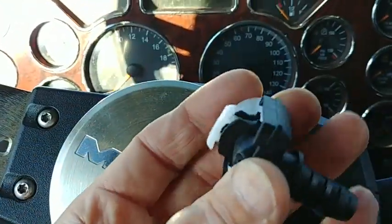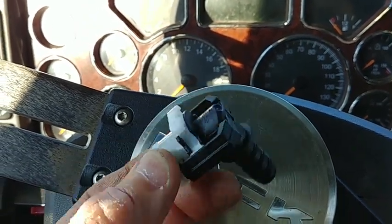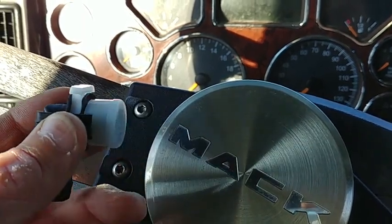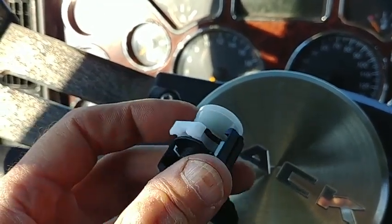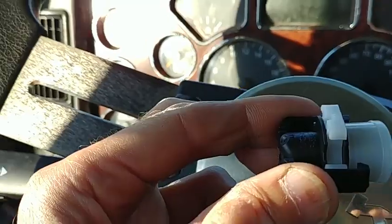So this is what it looks like. Basically, between the fuel line and the tank there are two parts. There's this plastic one — the fuel line goes in here — and then there's basically a lock. There's no thread, nothing. You remove this, and there's a little bit of glue and a little seal in there, and you push it in. It's a metal fitting that sits inside the tank, so this plastic just snaps into the metal. Very, very flimsy.